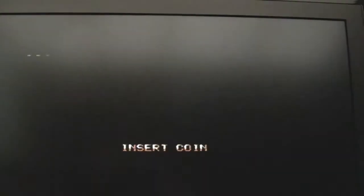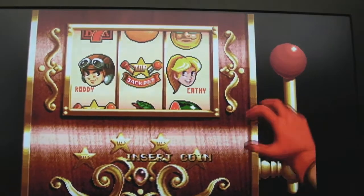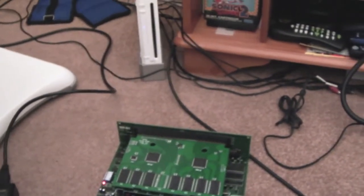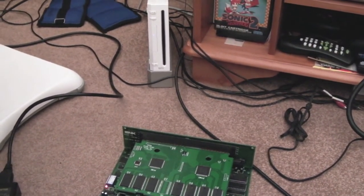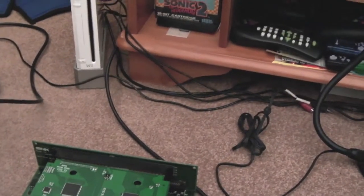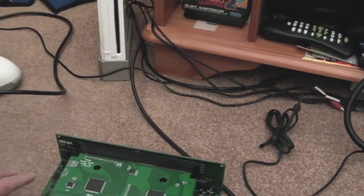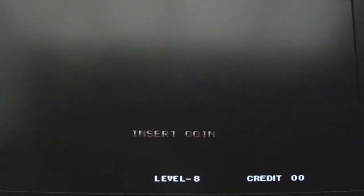Right, some corruptions, move my finger. There you go, solved. How is that possible? And just for the record here, this is not me putting pressure on the board. This is not a board problem. This is something to do with my physical interaction just nearby that area. It's like an RF. We've got an RF problem, a noise problem somewhere, and me interacting with this, just being near this at that relevant point there, look, so you can see it stabilised. Look, see, finger off, back, finger on.